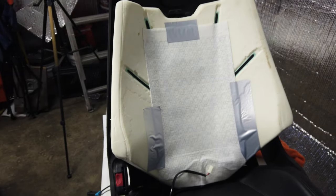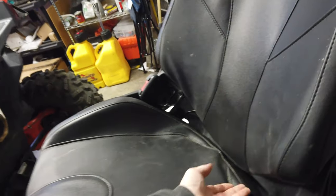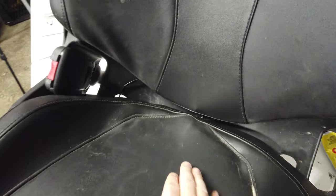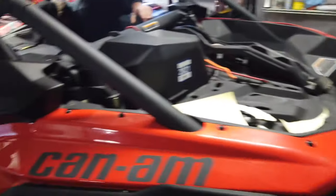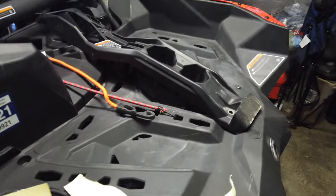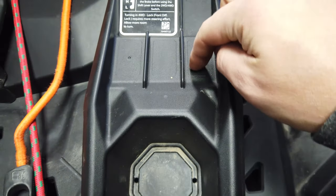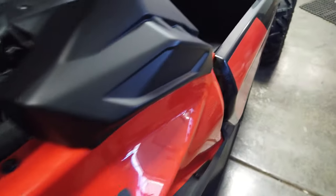Driver seat is all back together. Ended up using some zip ties since I don't have those little zip clamp things — button zips. That works out just fine and holds it on there good. The top piece is clamped — you can't really even tell it's got heaters in there. You can see a little bit of wiring right there, which hopefully you're not really going to sit on. Alex has been working on getting the center console out. Now I'm going to go ahead and drill these out right here, already marked out for them, drill and file it down until those buttons sit in here nice, then run the wiring back along here and over to the battery.